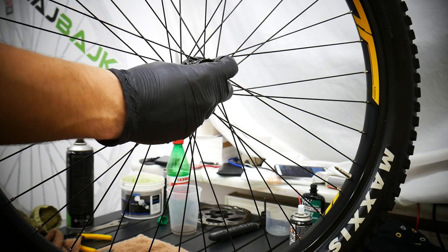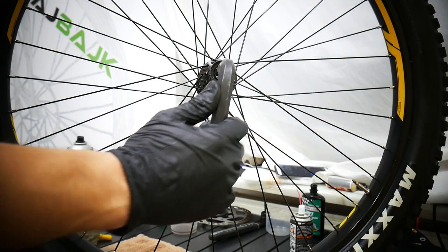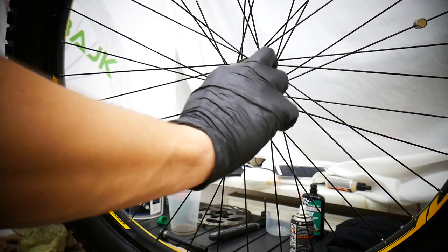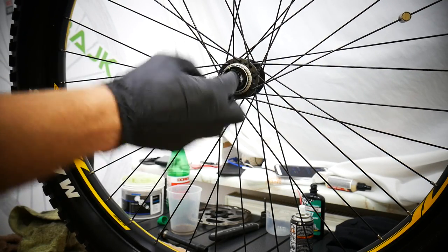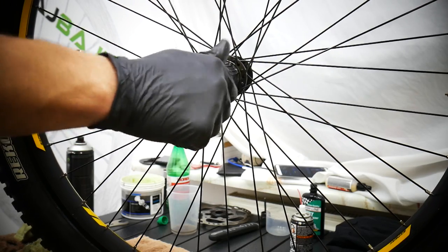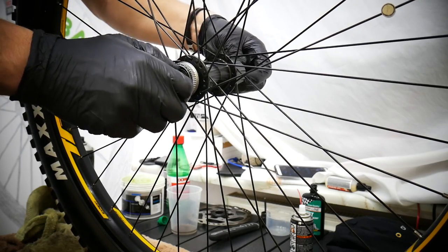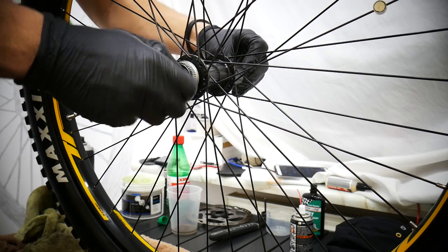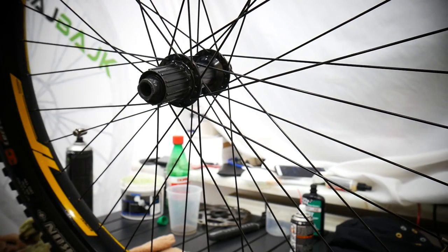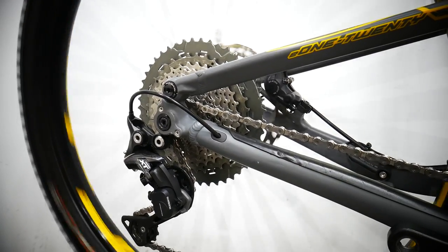Now clockwise I'm threading the freehub body back — when you pedal you actually make it really tight. I helped myself a little with the Allen key but it wasn't really necessary. Add some more grease on the other bearing side. As I said, it's good to service the bearings and freehub at the same time. Now we need to reassemble the cup and cone and then eliminate the play on the bearings, making sure they work nicely. Always check it before putting the axle, disc brake rotor, and wheel back on the bike. It should spin with no friction, very evenly. It's engaging nicely — this is the sound. Working great. See you guys!